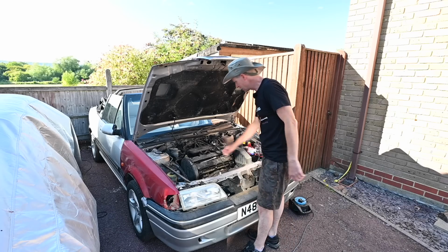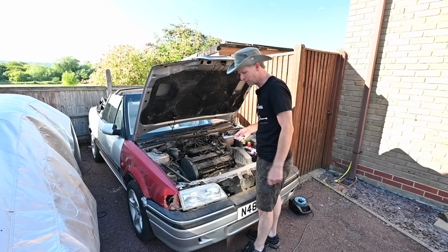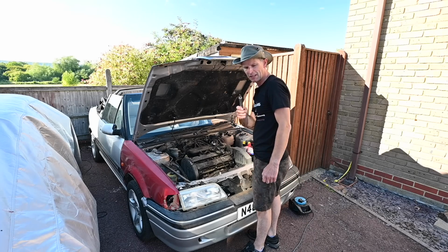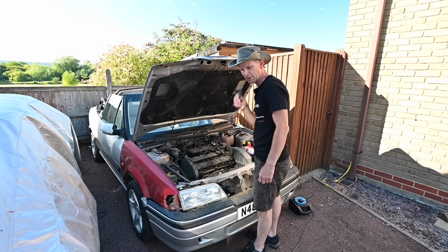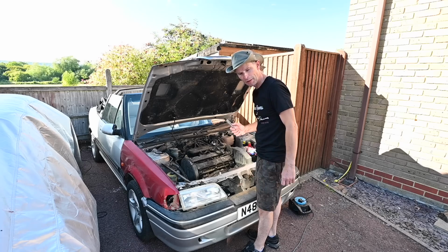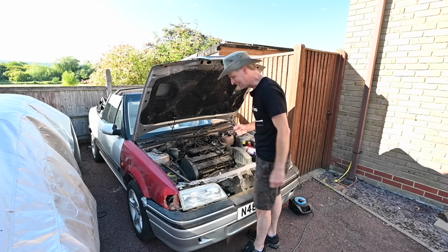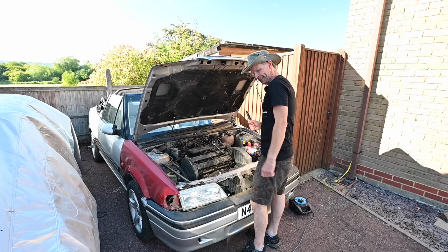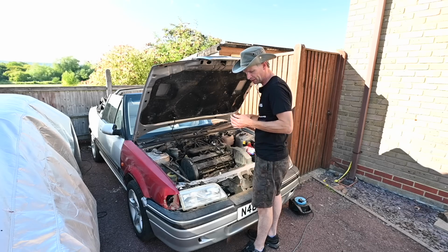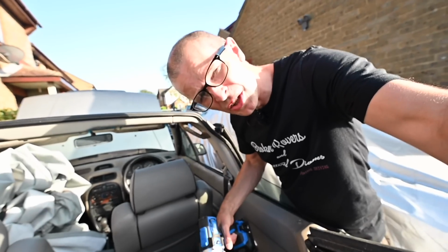But it's still just cranking and cranking. So instead of preparing for Nitro Silver's arrival to do my roof, I'm now troubleshooting why it won't start. And this is very black, but not very petrol-y. Doesn't really smell of petrol at all, so I suspect either the fuse, the relay or the fuel pump has just died on me. Great. So yeah, that's all good news. So also these plugs look pretty tired, so I need a new set of plugs in it. I'll return to the car not starting in a minute.